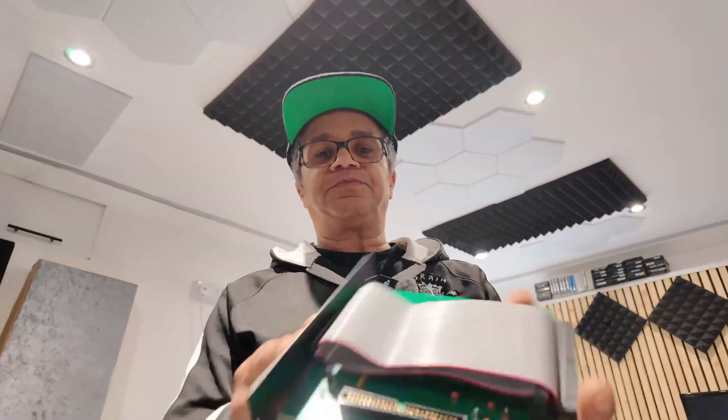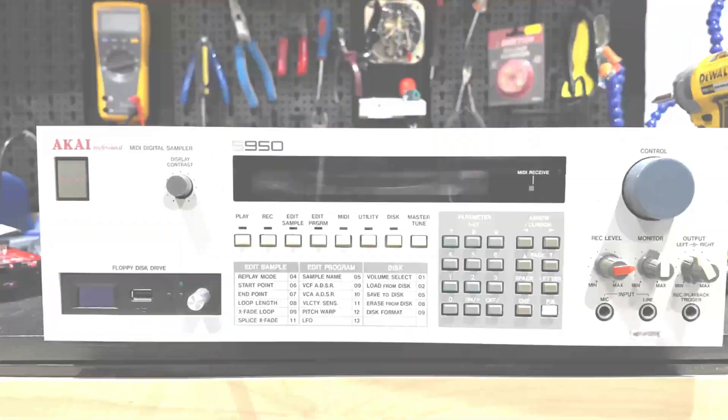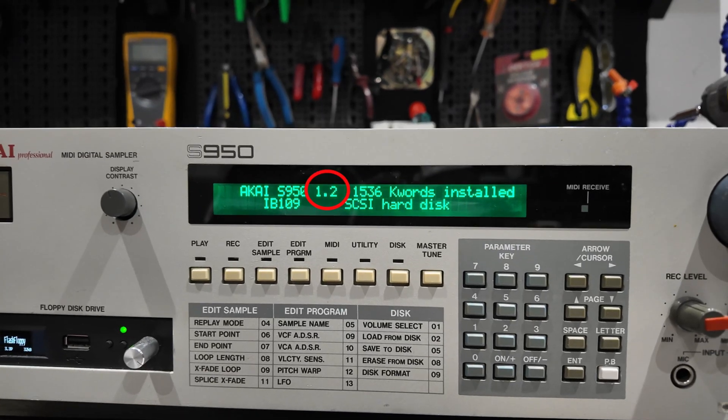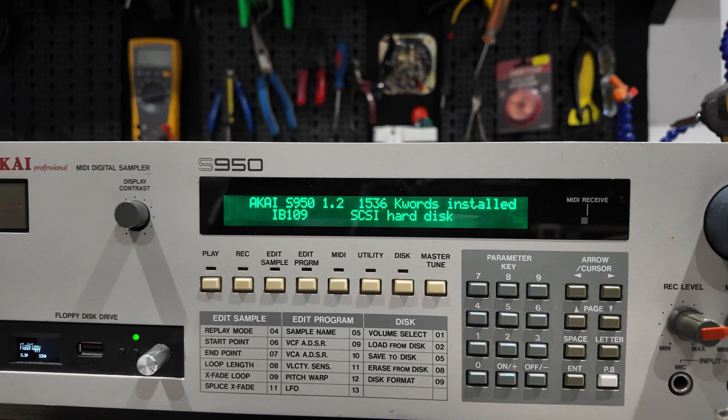There is a little bit of installation — you do have to upgrade your EPROM chips. They provide EPROM chips and the EPROM chips are basically version 1.2b. When you first boot the sampler up it should say 1.2 — it doesn't actually say 'b' next to it, so as long as it says 1.2, as far as I know this will work. If not, you can get the ROMs from them — that is the latest and last version of the Akai S950's ROMs.